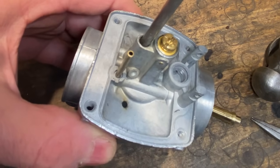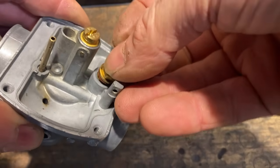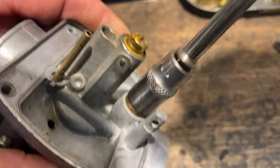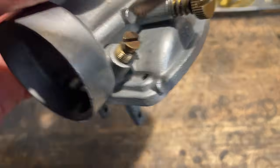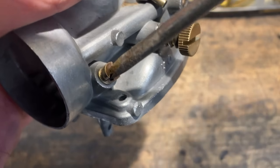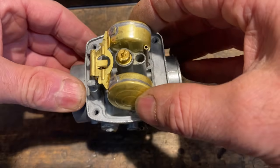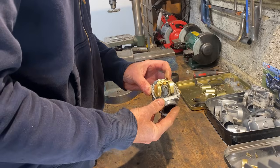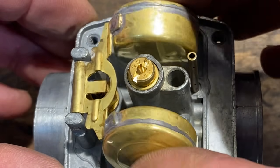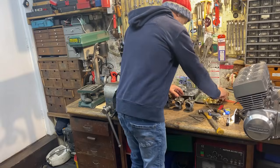The pilot screw then screws straight into the carburettor body — it's really important to make sure the screwdriver is the right size for the slot, otherwise you can damage them and then you can't get them out. I then fit the petrol cutoff valve, which just screws into the carburettor body, followed by the idle adjusting screw and air screw — screwing it right in tight then coming out one and a half turns. The fuel cutoff needle drops into the cutoff valve, and then I put in the pin and the float. I then repeat the process with the other three carburettors, bringing them all up to the same stage.